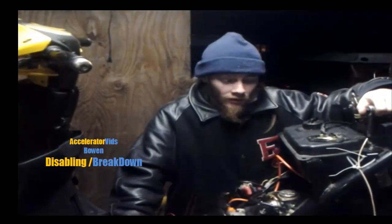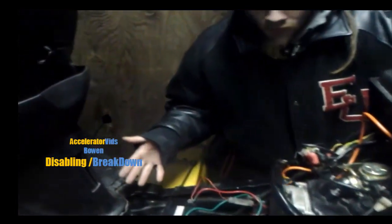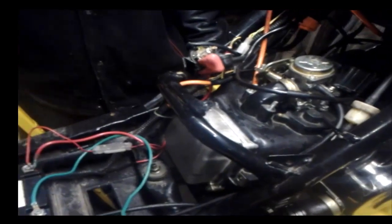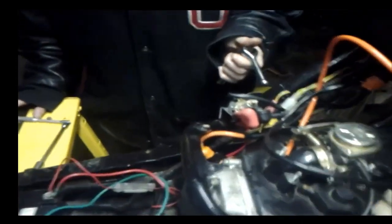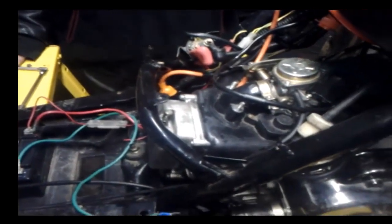Instead of doing PC work today, we're doing motorized vehicles. In this case, we have a 2006 Lifan QT-15. It was received with a blown head. Well, not head, but the rocker head. I guess they probably tightened the thing too tight and destroyed it. But I've replaced all that, and I've also picked up some aftermarket parts. Currently still doing some work to it, just replacing a head gasket because it leaks oil really bad, and once that's replaced, it should be all good to go.